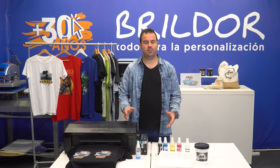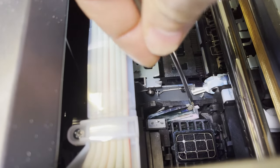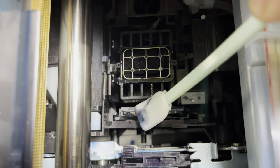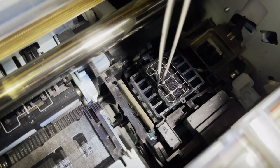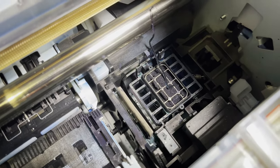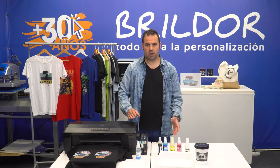To clean the wiper blade, unblock the head as already explained. With the help of a flat screwdriver, push the wiper blade to the back of the printer — you will see that it is full of dry ink. Clean it using tweezers and a cotton bud dipped in cleaning fluid. Do the same on the capping station, where you'll see solid ink on the edge. As for the head, we have already explained how to clean the edges once it's removed.